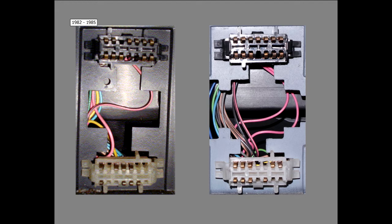The best place to pick up many of these connections to the dash modules is the stock connectors behind the standard instrument cluster. When you remove the instrument cluster, you'll see two 14-way connectors — a black one at the top and a white one at the bottom. This photograph was taken from an 82 or 83 car, and the pin-out applies to cars between 82 and 85. There's another configuration visible on an 86 Firebird, where you can see different pins fitted and the connections are significantly different.